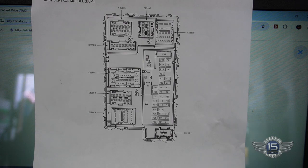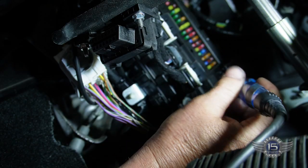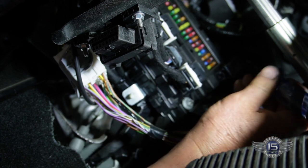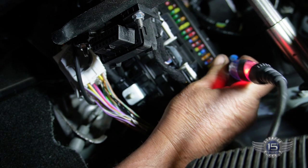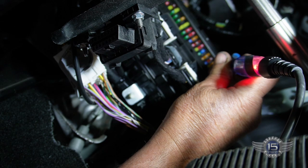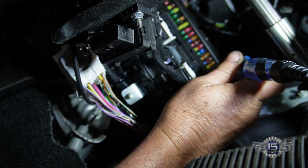A little 5-amp fuse, so it doesn't carry much amperage. Underneath the dash here, this is the BCM, those are the fuses. The one we're looking for is this — this is that triple fuse. You can see there's the center terminal and the left terminal. We're interested in the left terminal. The center of that fuse is hot — you can see hot going in. And if we come over to the left side of it, we've got power. We've got power at the fuse and through the fuse — both sides of that fuse are good. So the fuse is not our problem.